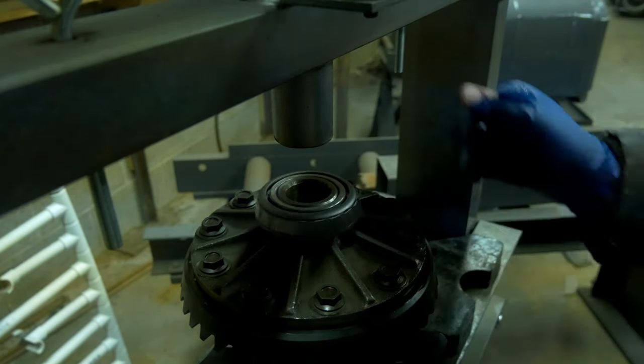These are the side seals. Again, you want to grease the lips, grease the outers, and then drive them in flush, just like you do with the pinion. So there's a little STP grease, which is stay together please grease, and you want to lube it just a little bit. A little goes a long way. You don't want to cover this stuff in grease.